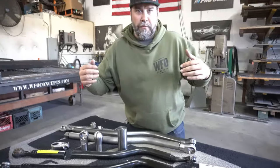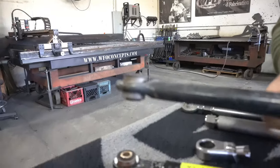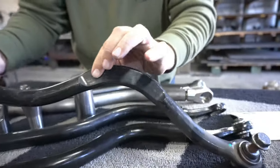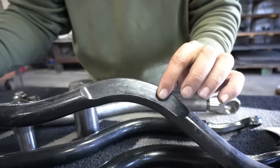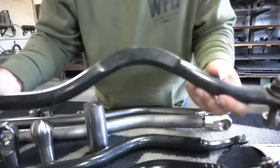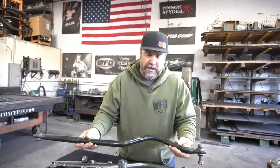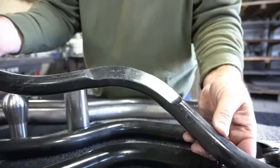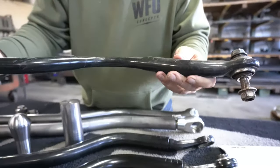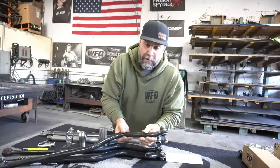To start, we're going back in time to the JK world. This is a JK front track bar — it's solid steel, and as you can see in the middle, it has this smashed-down spot. What a lot of people don't know is right there in the middle, they actually created a spot that was made to break. So if you slam into something, hit ice, go in the ditch, this track bar will snap right in the middle. We saw a ton of them on the ground in Moab at Twisted Jeeps when we rented our Jeep.